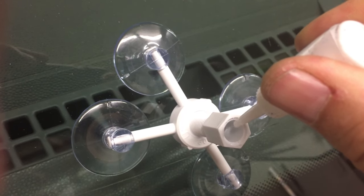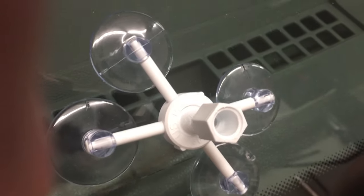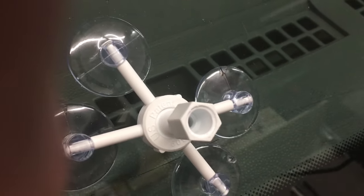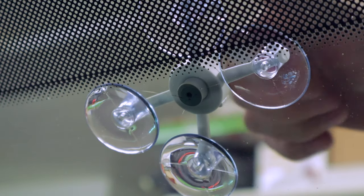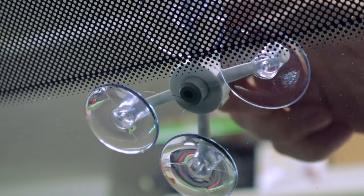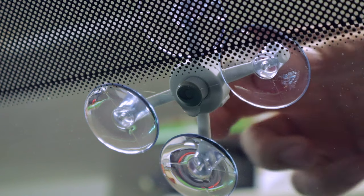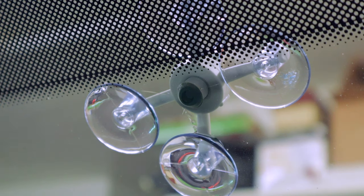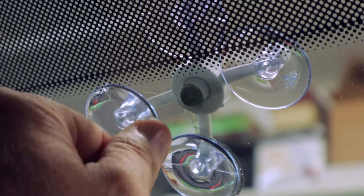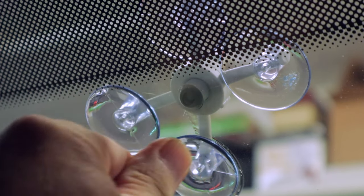Small chips take three drops and larger chips take six drops. Then insert the plunger, and you can see from the other side as you put the plunger in, it kind of flares out that piece of rubber. I used too much of the resin on this one, and I need to press that a little firmer against the windshield to keep it from running out the bottom. You can take your finger and press on the back side to help work out the air bubbles and let the resin flow into the crack.